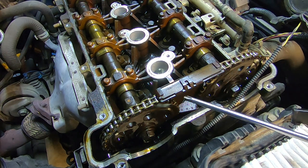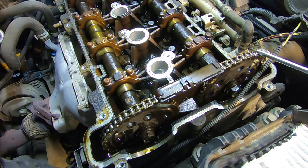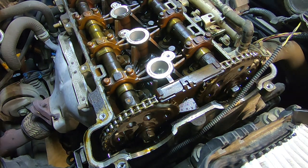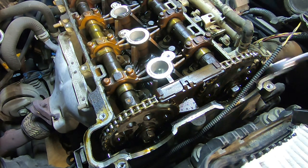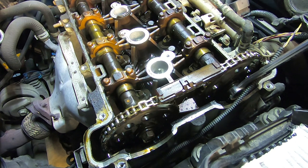That's the reason they put this guide here. When you get a little kickback and a little slack in here, this guide holds the chain in position so it won't jump when you try to start the vehicle. If you look online you'll see video after video of people playing with slack between these two sprockets and thinking they need a new chain. Now if you were an unscrupulous mechanic, you could put an 18 millimeter on this sprocket, move it backwards, and create all the play you want.